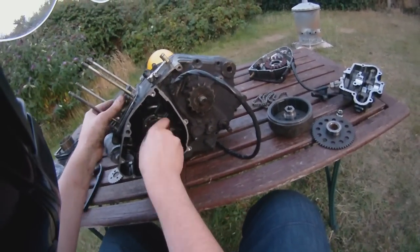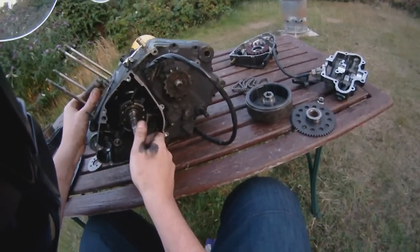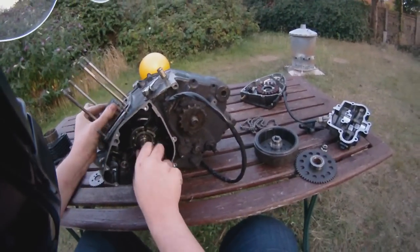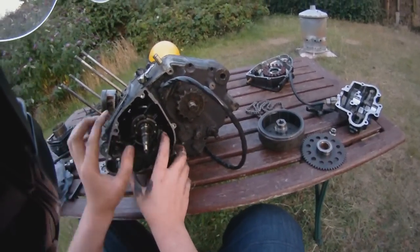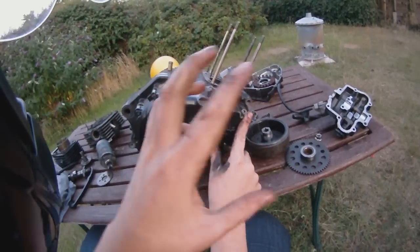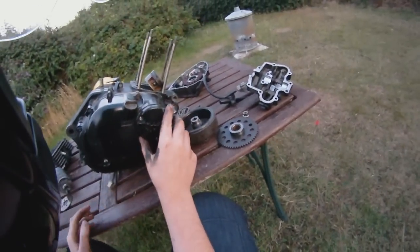Right now we're down to this, which is what the cam is attached to. By the piston going up and down, that's what causes this to turn. Your motion of up and down is converted into round and round because of the crank. So that explains how one side of an engine works — that's all the power creation. Now what you need to do is take that power and transfer it through the gearbox. To get it from the engine to the gearbox, you have a clutch.